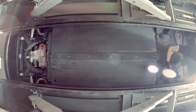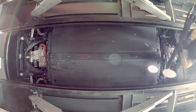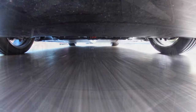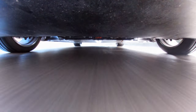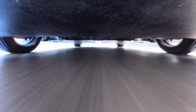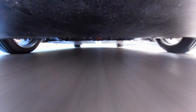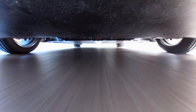Joe has finished and taken off the front and rear aero covers. We took the car back on the road to see what it was like without them. The first thing we noticed was an increase in noise generally due to airflow not being clean under the car. There was also a kind of vibration throughout the car through the steering, again due to airflow being interrupted by the exposed drive units and other parts.